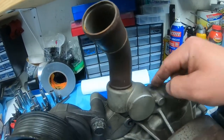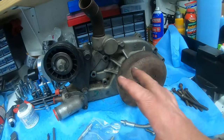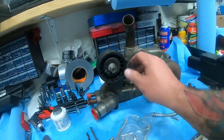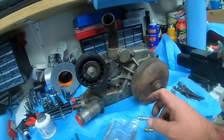You want to be real close to it. But I found out that the truck water pumps, and another reason why we're not buying aftermarket, we just feel like it's a waste of money. I know they look beautiful. It's good for a car show and whatnot. We're wanting dependability and we're wanting a race car. So we're going to put the serpentine system back on it. Very, very dependable, even at high RPMs.